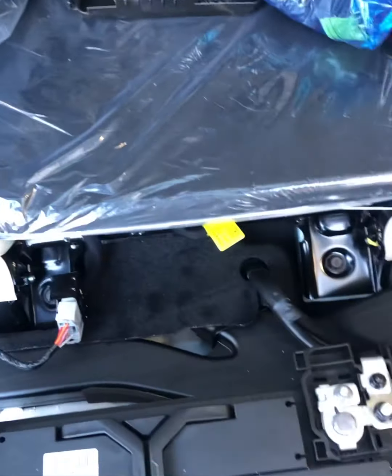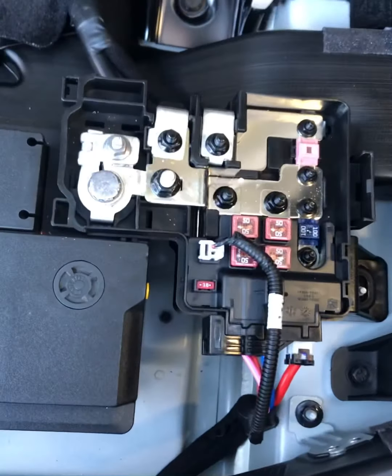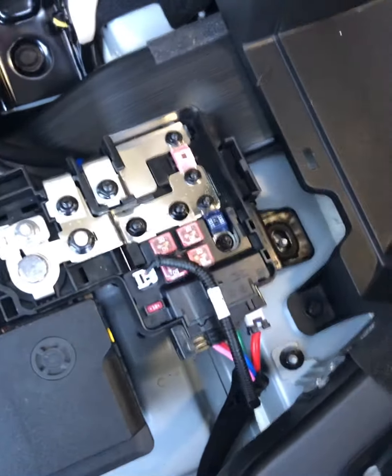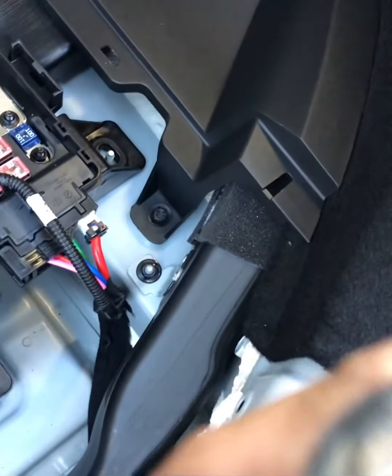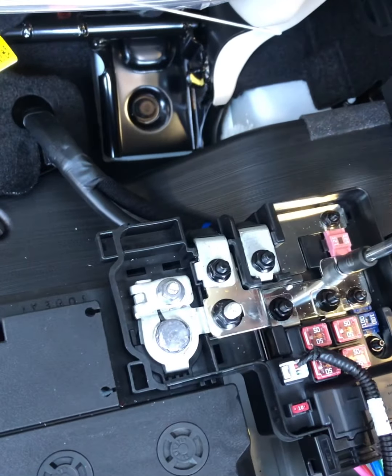So now we went to our engine room compartment and we found that there was no power on one of the main fuses there. And we found that one of the big fuses here, I don't know what that is, we're gonna find out later what fuse that is, but most likely that's an alternator fuse, but it should still run. So I found another fuse. Let's remove this and let's see if that will power up all our electrical components.